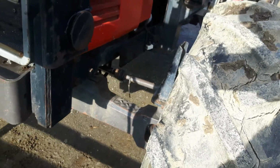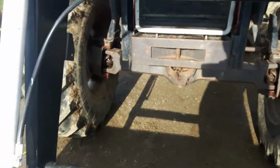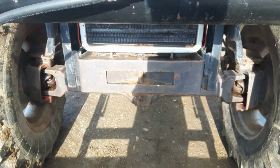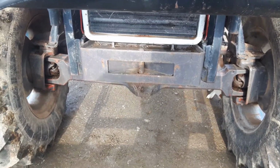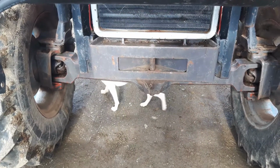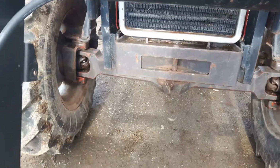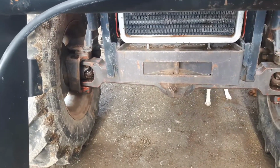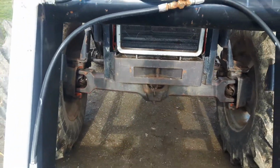Yeah, but of course now I haven't seen it leaking yet. I can smell it, but can I show you in here? The axle seals in the housing were leaking, but I believe that was caused from the binding. With pressure on the seal all the time, it kind of leaks out by. But I haven't seen it leaking. I pressure washed it all out there, and I'm just running around in two-wheel drive, of course.